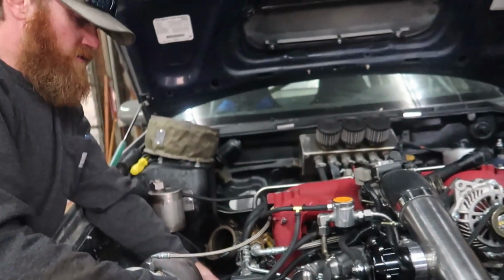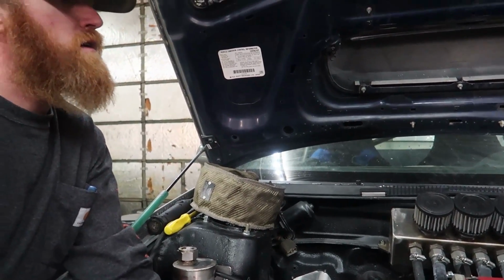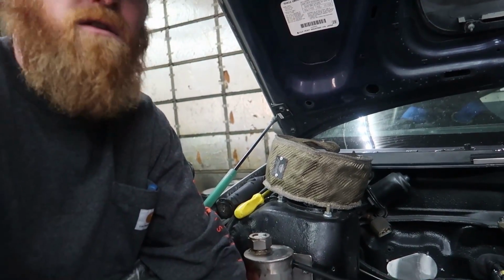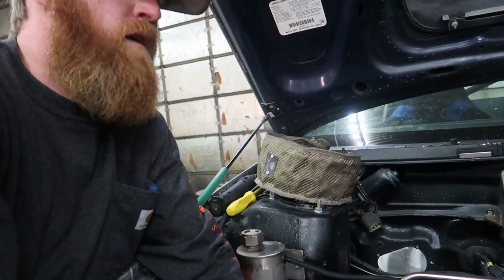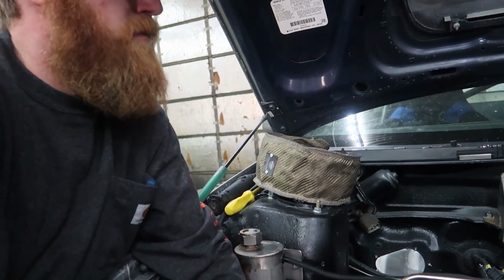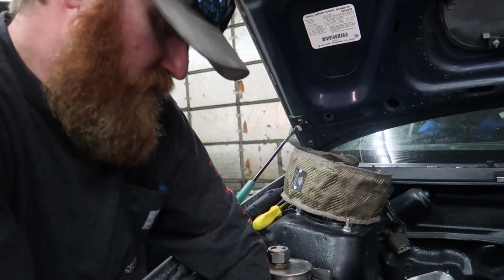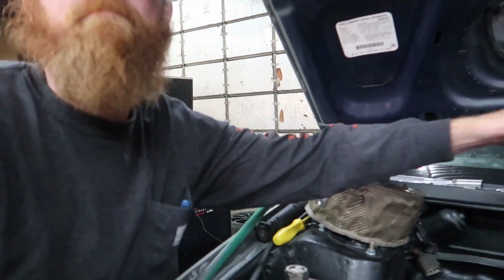One of the biggest things I actually read about while I was away is cooling to the back two cylinders. On cylinder three on the old Subaru here, you usually have a coolant port that comes off the head and goes up to a turbo. Well, I don't have that, so that was just plugged. And on cylinder four, there's never anything. It's always just been a plug. And mad props to Dominic Isha for figuring out the reason for the common failures in cylinder four is a cooling system issue.